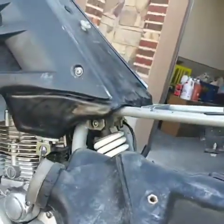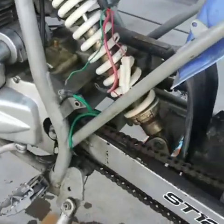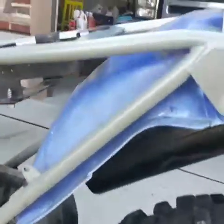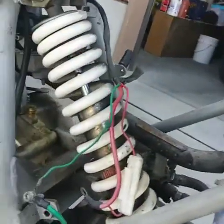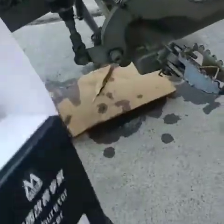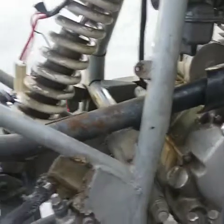Anyways, so here we have the air box that was sitting right here, but you had to take it out to really get the carburetor off. The whole thing's a pain because this rear plastic has to come off and slide it out. And so to eliminate all that, I have extra air filter pods sitting around. So we're gonna go ahead and just put that on and eliminate the whole airbox itself.